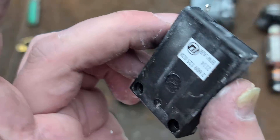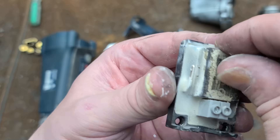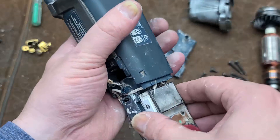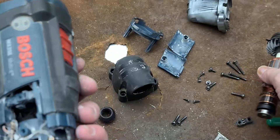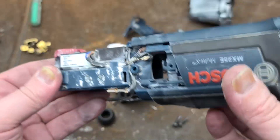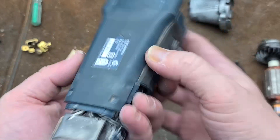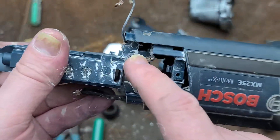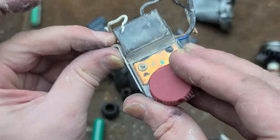Here's the switch — it's a very specialized switch, all potted in there. It has three connectors — pretty solid but a more expensive setup. You'd think they'd just use an angle grinder switch or something more standardized. This is a magnet ring, and we can see two little wires from the controller — those aren't power wires, those are for a little sensor. It's a constant-speed unit. This last portion slides out on a dovetail — that is indeed the sensor, and it sits right there on a little spot.